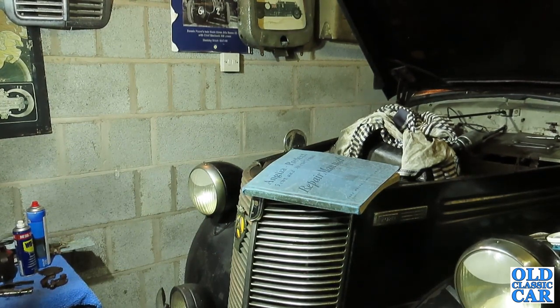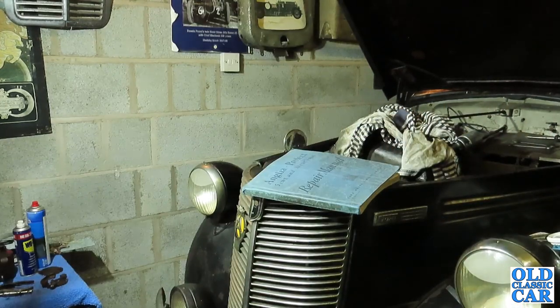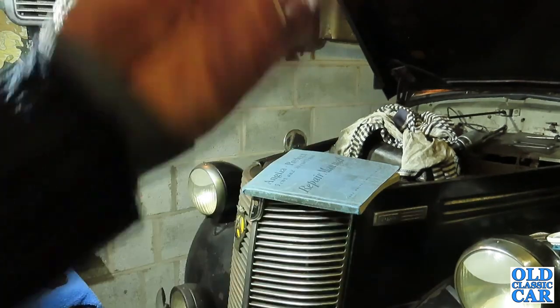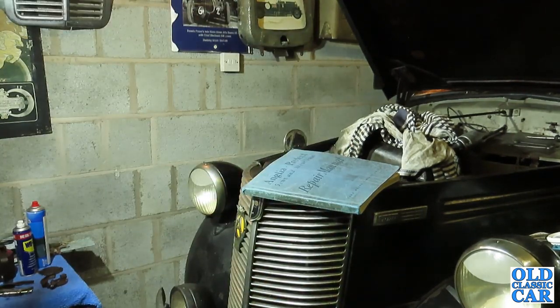The spare engine, I've left the diesel inside that, and that can sort of pickle away to itself, and hopefully that diesel will find its way around the rings and around the valves and so on, and then we can try it with a bar on the front just to see if the engine will turn over at all.